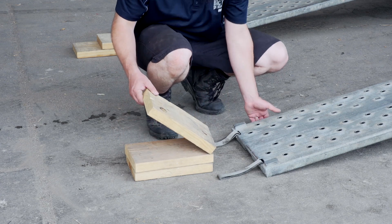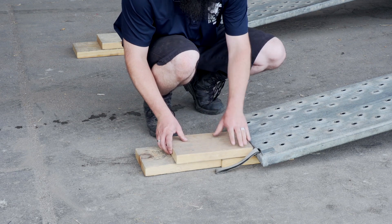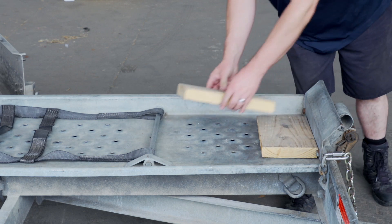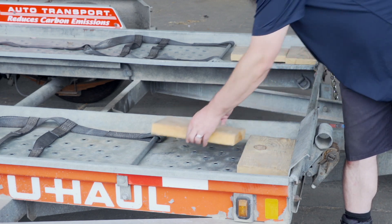Since your vehicle has low clearance, you can raise the vehicle clearance by laying three 12-inch long 2x8 boards on the ground in a pyramid. Next, place two additional boards on the trailer deck to clear the tire stops, and then repeat on the other side.